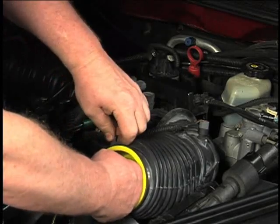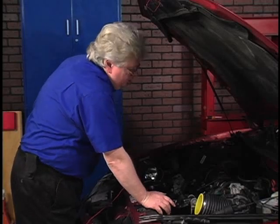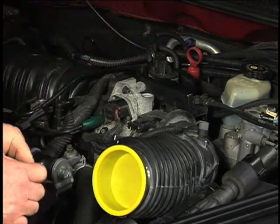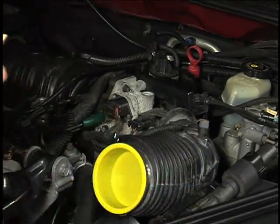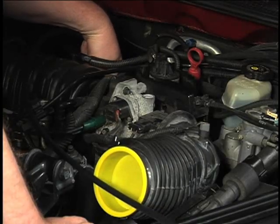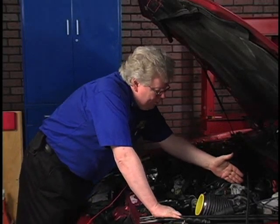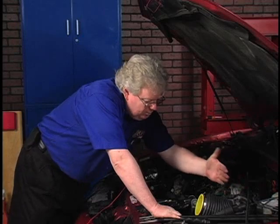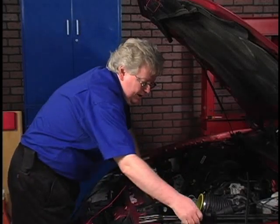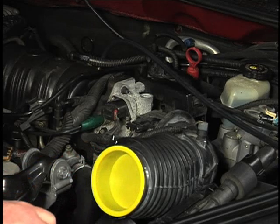Now I want to put some smoke in. If I don't have any leaks, won't see any smoke come out. I'll grab a hose at the back of the intake manifold where we have our vacuum storage tank. Pop that off. Get a piece of rubber vacuum hose, 3/16ths, go on the end of our little cone from our smoke machine. And there's where we're going to insert smoke at the back of that intake. Even if there is a little bit of an opening with the min air rate, the throttle plate open a tiny bit, we should still block the smoke from getting out here. Then we look for anywhere else the smoke might get out. Go ahead and get our machine ready to go, hit the button and let's see where the smoke comes out.